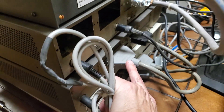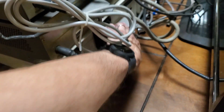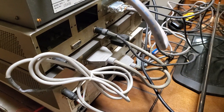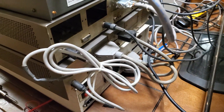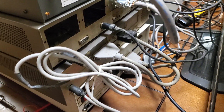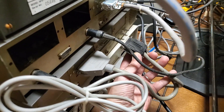So we have a crossover going from one to another. This big one is the hard drive connector, and that goes down to the hard drive connector. Now, I have to correct something from the last show. I said I had three DB25s, which meant three RS-232 ports — that was incorrect. In fact, one of the DB25 ports, which I'm pulling out there — if I can get really close, we can look at it.